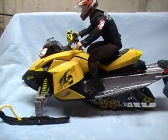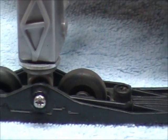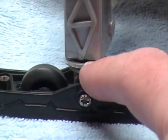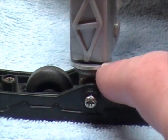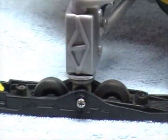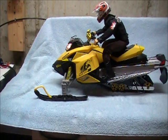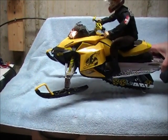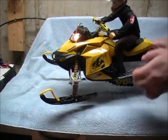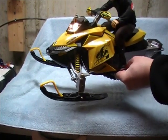One last thing: I did some work down here on the skis. There was a little clip along the bottom that stopped the skis from turning when they got to a certain degree angle. So I clipped them off and put washers there. Now the turn radius is much, much better. That doesn't look like much, but on the snow when it's moving, little motions make a big difference.